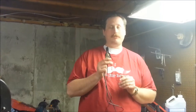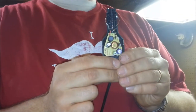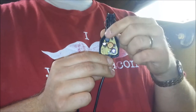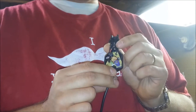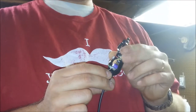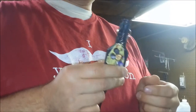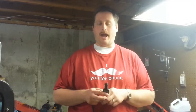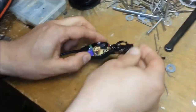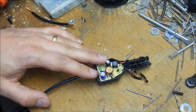I'm going to take the adapter apart and show you how there is a black and a red wire — the red line is the live wire and the black is the ground. I'm just going to solder another wire coming out of that hole and use that as the way to connect it. This adapter will not be usable the normal way anymore, but that's okay — not a big issue. I'll go ahead and do that right now.